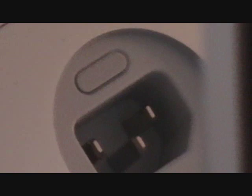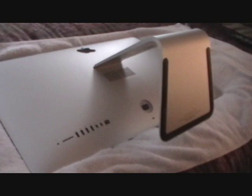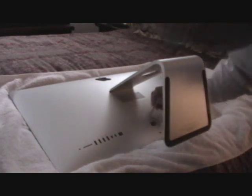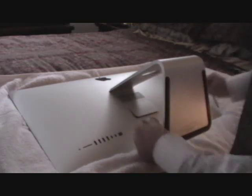If you take a look at where the plug plugs in — let me zoom in — you see that little notch above the plug that you need to push in, and that causes this little hatch in the back to pop open. I've tried to do this with my finger, but I can't push it in enough — my finger's a little too big. So you have to get something to help. What I use is actually like the back of a spoon. It's not too sharp and it fits right in there. So I just go in and push it in, and then this pops open.